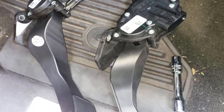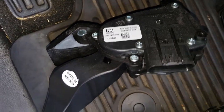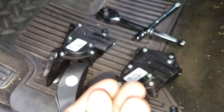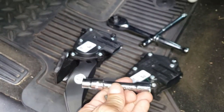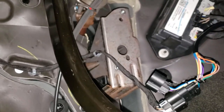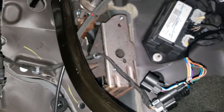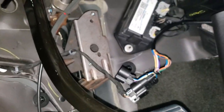I got it out — the one on the right is the old pedal. Let me see if I can get it to focus: that's the old pedal part number and here's the new one. The pedals are dimensionally identical as far as I can tell. There are two bolts on top — pretty easy to get off, but there are tons of threads so get out your power tool, don't even bother using a ratchet. It's kind of hard to reach the top bolt; I had to use a stubby extension because the long one was blocked by that AC vent over there. You can see that rusty steel box the pedal attaches to — a lot of people shim the bottom part to keep it from flexing, but my bracket doesn't flex at all so shimming doesn't do anything.